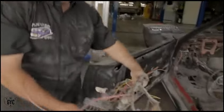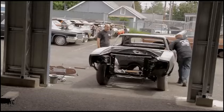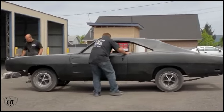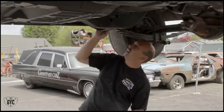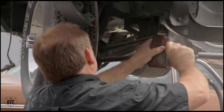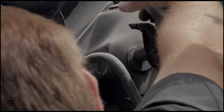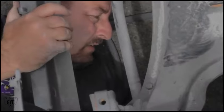We've got the car unpacked and all the bolt-on items out of the vehicle. The only things left on it before we send it to the blaster are the front and rear suspension. When you're sending one of these cars off to have it media blasted or dipped, you have to have everything off except for the actual body panels — that means front suspension, rear suspension, motor, transmission, lines, brakes, hoses, glass, trim — everything has to be off for them to get in and actually clean the original panels.